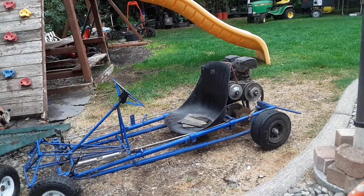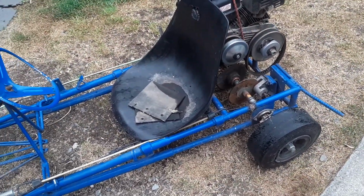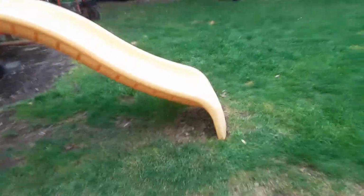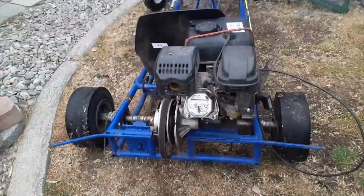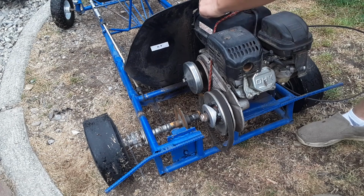As you can see, this cart has a few issues. The axle's extremely bent, the brake caliper isn't mounted right. The bar going back to the brake caliper to engage it has no clips or anything holding it to the pedals, and the disc has no collars, so it's just sliding off. I also robbed collars for other things. The axle's just sliding through right now. There's no chain on it. Bolts are out of the muffler, the fuel tank mounts are destroyed. There's a lot of issues.